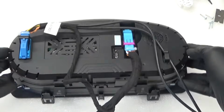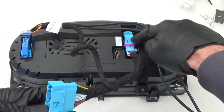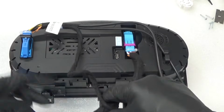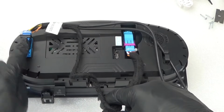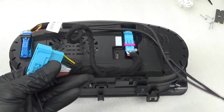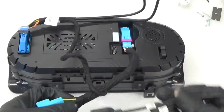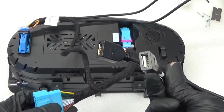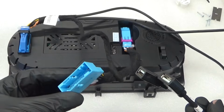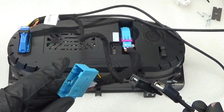What you'll do with your wiring is, you've got your light blue plug there, the original plugs into that like that, so that one goes in there, the light blue one, then the dark blue one goes up the other way and clips into that one, and then you've got this connector, and you've got two spare ones like this on the other end of here as well, additional ones for extras, and that plug will plug into the original harness in the vehicle.